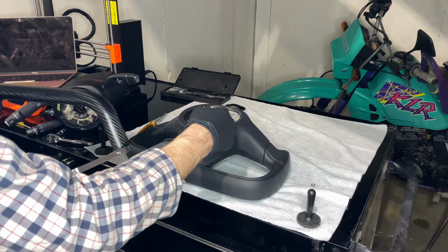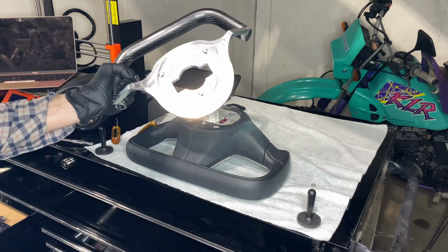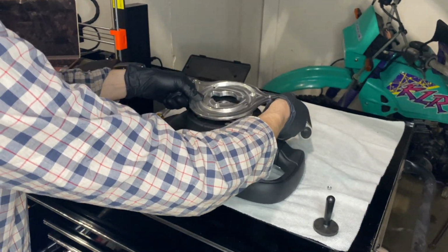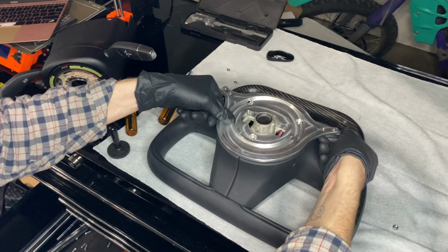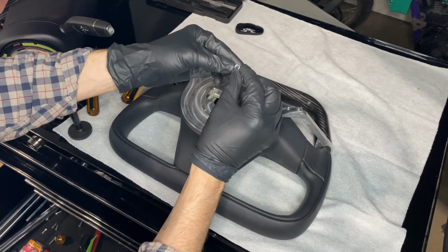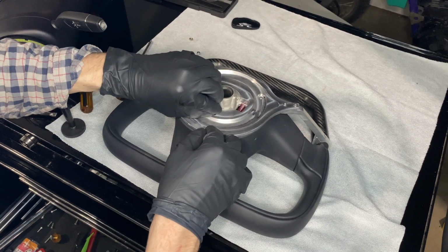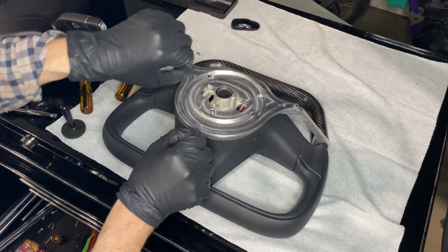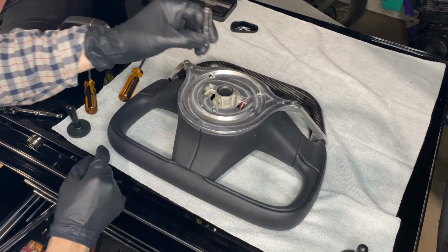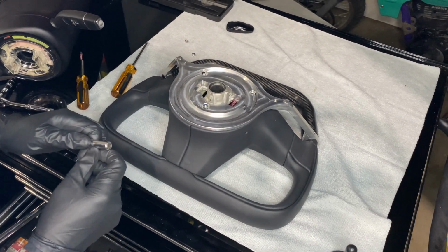All right, now that we've installed our 3 replacement screws, you can see they stick out. That's what will allow us to install the completer assembly. It fits over like so. 3 nylon locking nuts will be threaded on. Once I thread those on, I will hold my driver on one side and my 8mm on this side and tighten them nice and snug.